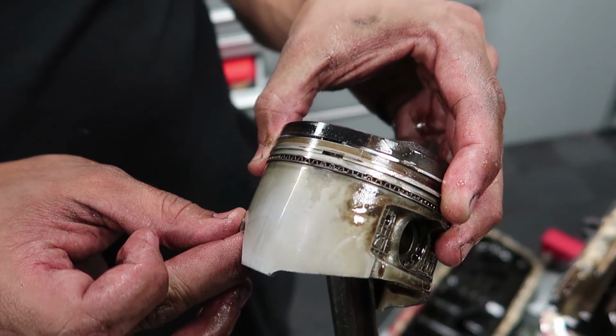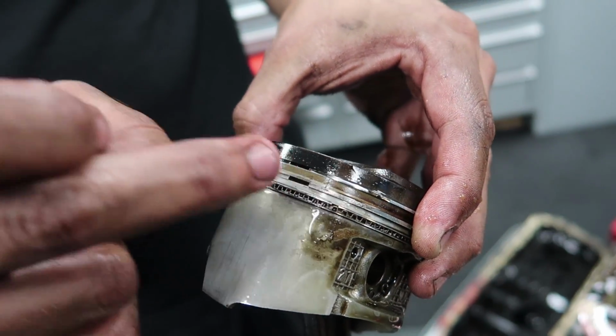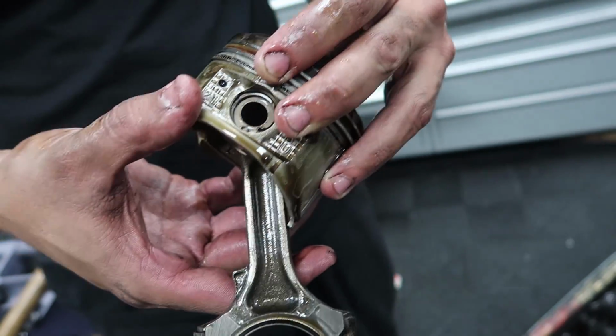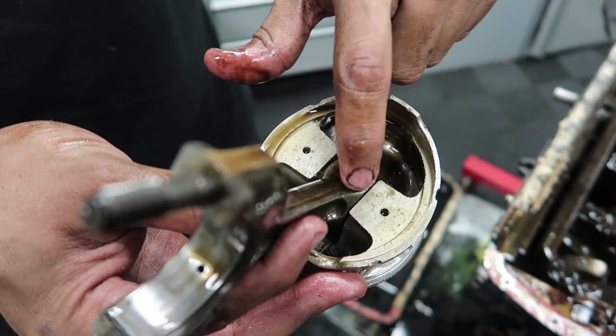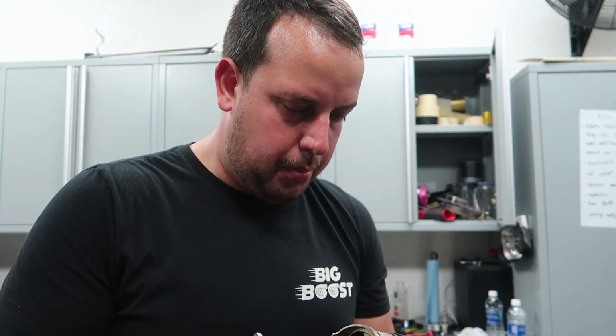This is the 5th cylinder. And it's broken in the same spot here and here on the flat, so I was like, why? Consistently broken. Yep. I just want to find where that aluminum came from. Well, there's some marks here, like some stuff flying around. I wonder almost if this engine was blown before and they rebuilt it, but they never fully cleaned the engine before. So there's just all that metal floating around? Probably. I mean, we still have 2 more cylinders to check. But that'd be so sketchy.